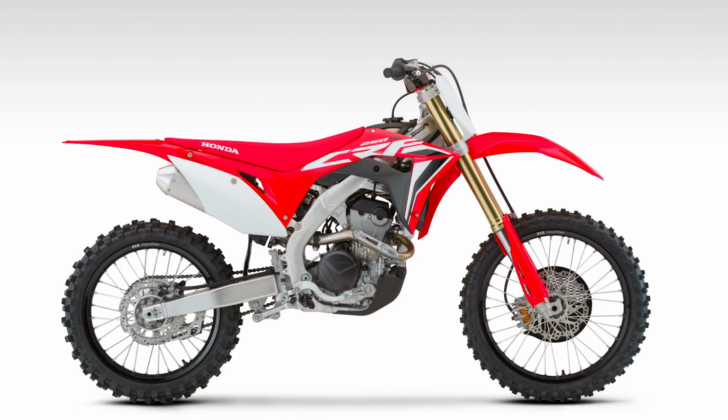They actually go through a little bit what the suspension setting changes are going to be to this model. The fork has increased low-speed damping, and the shock has increased low-speed compression and reduced high-speed compression. So they're saying this overall improves the handling characteristics, stability, tracking, turning, and traction. So basically, at that point, it seems like the bike's going to be a little bit more settled in the rear, possibly. High-speed compression seems to affect how the bike squats typically. Low speed might affect how it hits acceleration bumps. And then if the fork has increased low-speed damping, it might hold up a little more.